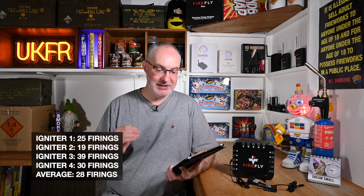So what to make of test number 2? Well, here are the number of firings until the first failure. 19, 25, 30 and 39, much better than 13, 14 and 15. The average now is 28 per igniter, that's twice as many as test 1. 15 igniters supplied with this unit times 28 is the equivalent to 420 disposable igniters.